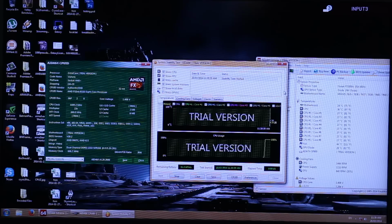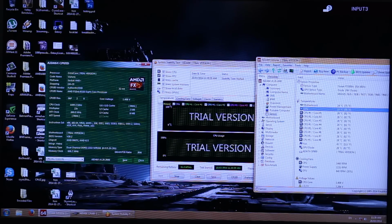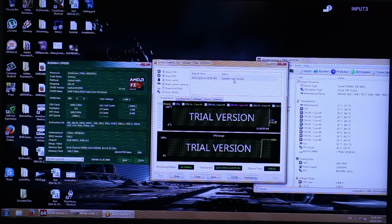This time around, it should go a little bit higher. I imagine the CPU should hit around 40 degrees, maybe a 22-degree delta. It hit about a 20-degree delta when I was on my Strike X open air test bed. I think the cooling's a little bit better on that rig than it is on the Zalman Z3 Plus. Only slightly, it's not night and day, but it's a little bit better. Anyway, I'd say we're going to reach a delta of about 22 degrees. If we did this for 10 minutes, it may go up to 41 degrees.